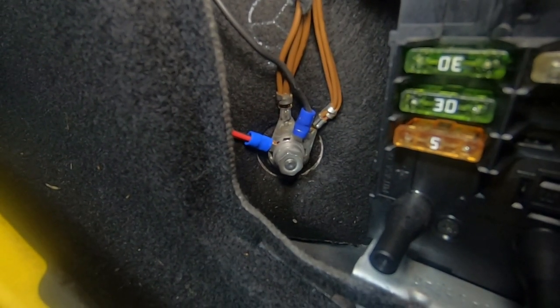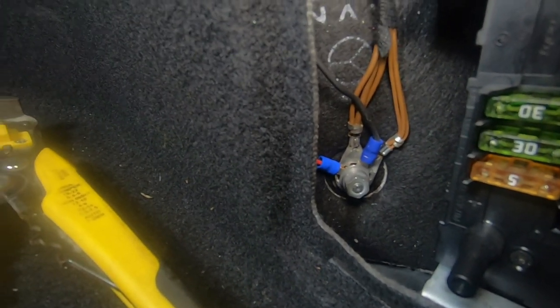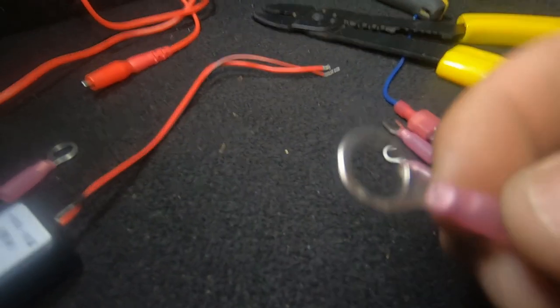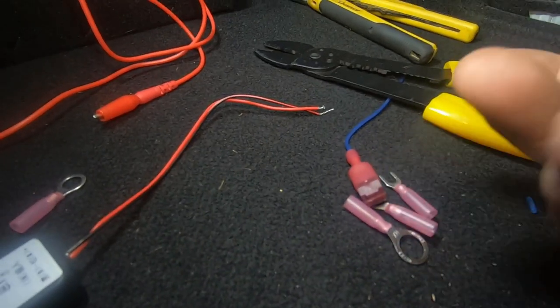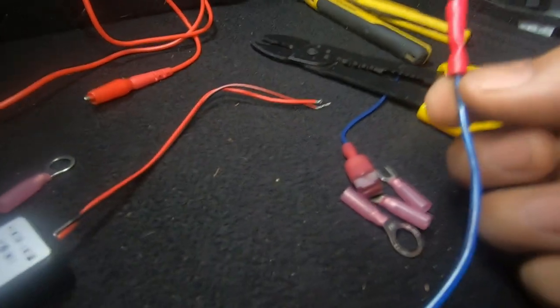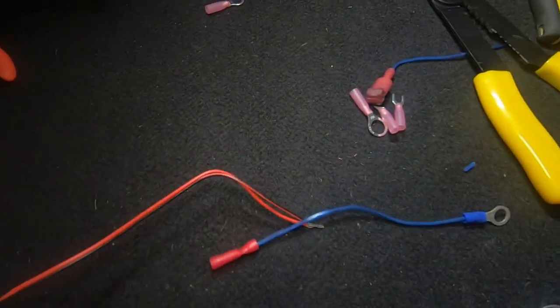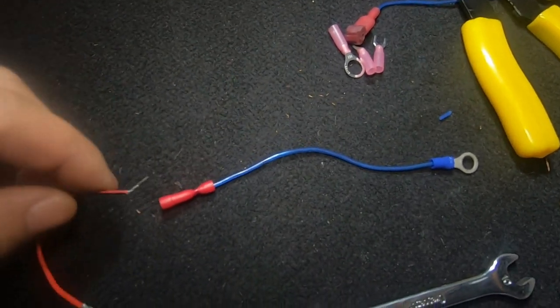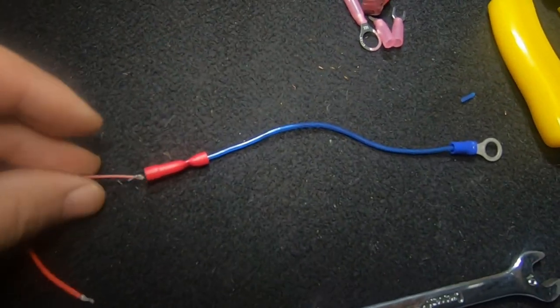As you can see, I've used a couple of rings already as a grounding point and it's worked out fine — it's perfect. It's totally up to you what you decide to do, however as long as you have a good grounding point and you find the correct insulated connectors, then you're good to go. That's all you need to do in order to extend your wire if need be and make a ground connection. If you needed to extend the cable for this, you would twist the cable down, fold it over, put it inside your butt connector, and crimp it down. It's not that hard — you can buy packets of these with all different sorts of rings, connectors, butt connectors, and insulated connections.